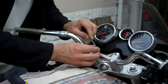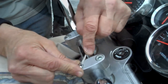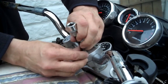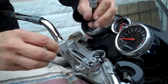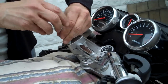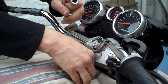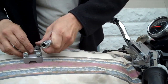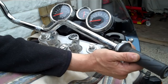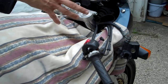Now we're going to literally take the bars off — take these little covers off, then take the clamps off. They're not sided or handed so just use your brain, sit them there neatly. This is where leaving the switch block in place comes in handy. Once you've got the clamps off, save the screws, then hold the switch block in place, leave it where it is, and just pull the bar out of it — leaving it there. You haven't disturbed the cables. No need to disturb the cables at all.